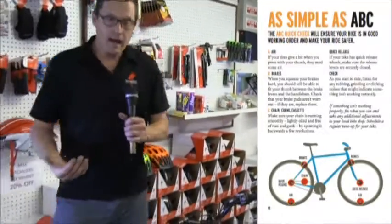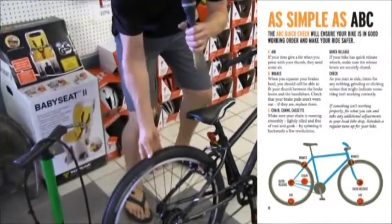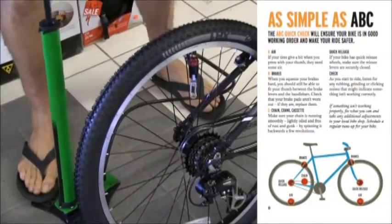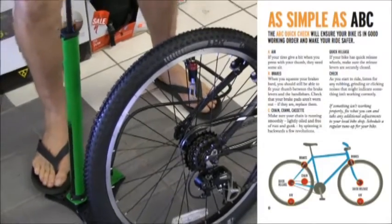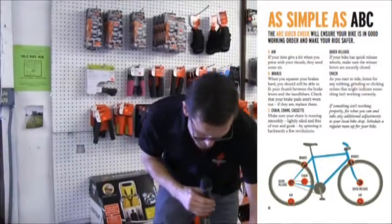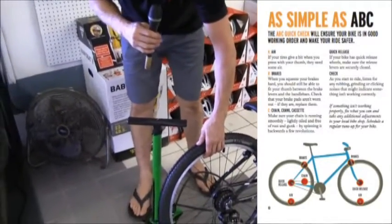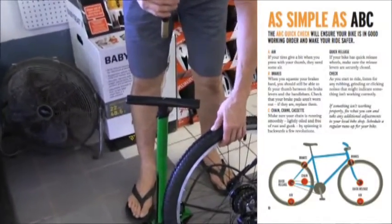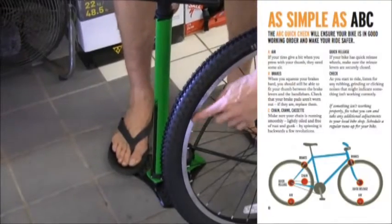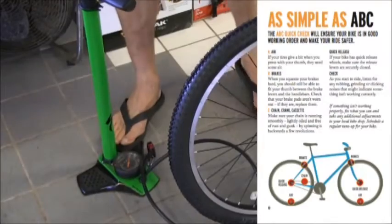The A is going to stand for air in the tire. So what we want to do is if you can pinch an inch on your tires, we're going to want to put air into the tires. The easiest way — the cheater way — is the pinch is the inch. I was able to push down with my thumb and I got an inch. Now if you push down really hard, you're barely able to move the tire tread. There will also be a tire pressure rating on the sidewall of the tire. Make sure to use a pump that has a gauge — that way you'll keep from exploding your tire.